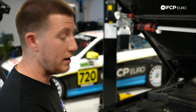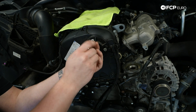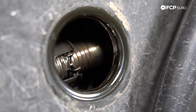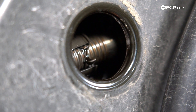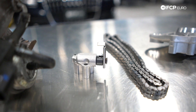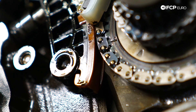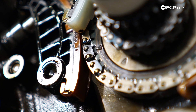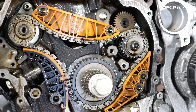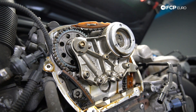Moving to the front of the cylinder head cover, you'll see the upper timing chain cover. This 2-liter may have timing issues because the chain stretches over time, and the tensioners are known to fail on them. Audi did come out with an updated tensioner to fix that, but from what I've seen it only helps to some degree. When you own this car, you're probably going to do a timing chain and tensioner at some point. A good indicator is fault code P0016, which means the cam-crank correlation is off — the ECM is saying the crank and cams are not timed together. As soon as you have that fault, turn the vehicle off and start planning a timing repair.